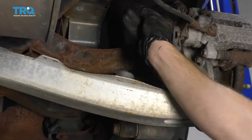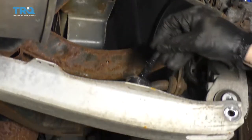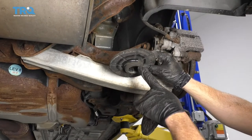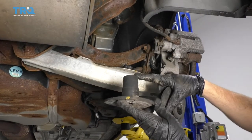I always like to try to put a little bit of grease right along these areas here — that's just where those little bushings are gonna go. We want to make sure that they slip on there nice and easy. If you look at these two bushings, you're gonna see they're very different. The one that's mostly flat is gonna go up along the top, and then the one that has the little nub is gonna be along the bottom.